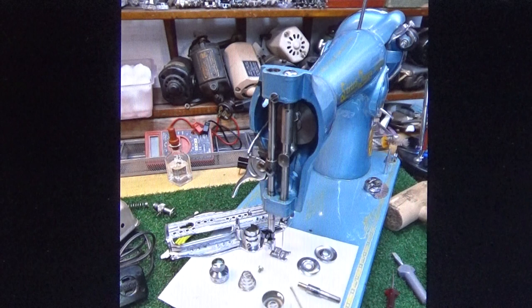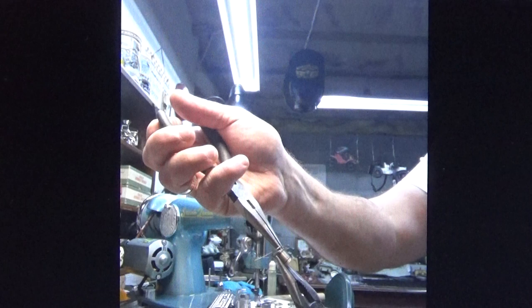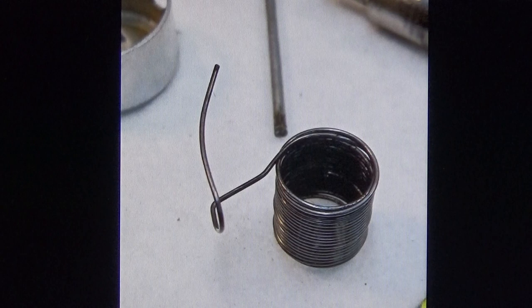Tearing down that upper tension completely so I know it's going to be functioning exactly as it should. You can't just swap between the discs. That is a myth constantly propagated on Facebook and groups, and it's absolutely false. That's how far you've got to go if you want to have the machine fully optimized, and sewing page 34, like you've seen it today, on light materials, on crazy thick, ridiculous materials, and everything else. Here, making some adjustments because that spring had been stretched at some point and it had to be compressed back.